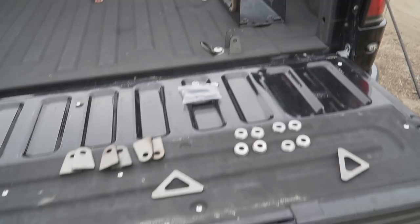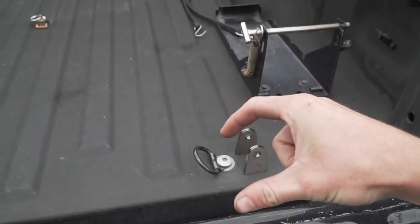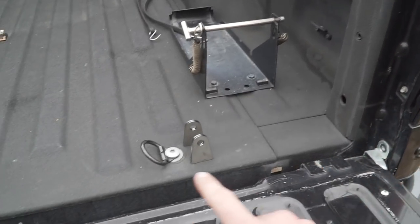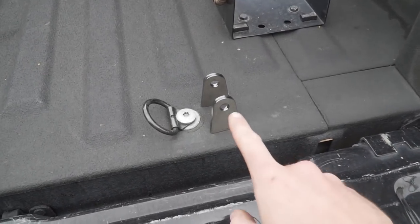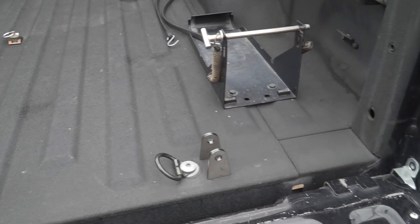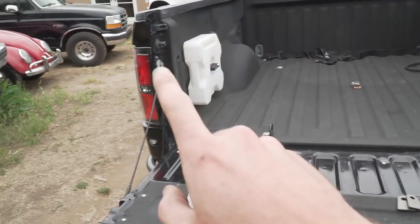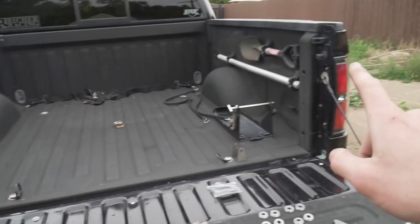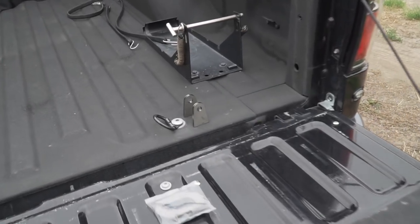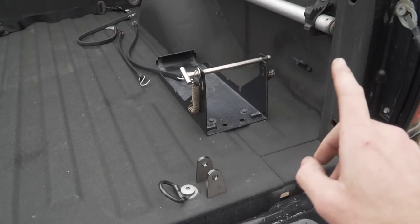So my plan with this is I have a bunch of different parts here. I'm going to be using some 3-inch wide by 3/16 thick plate. It'll basically end up being an L-shaped piece right here, and then I'll have a linkage that goes from these tabs right here to another set of tabs up here. Then it'll run in between out of some inch-and-a-quarter tubing, so it'll definitely add a bunch of strength to each side of the bed. These points want to flex when you're in the dirt and the truck's being abused off-road — they just want to flex and do weird stuff.